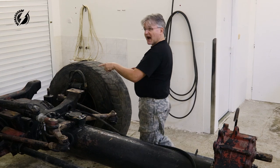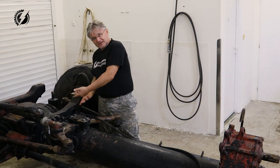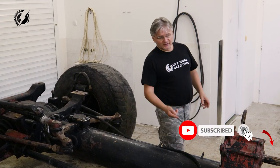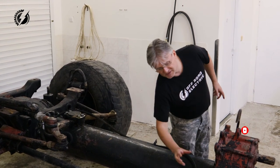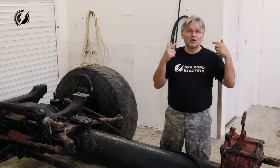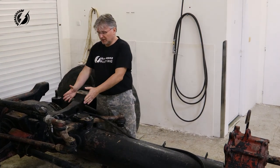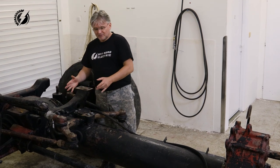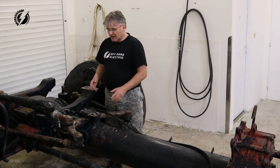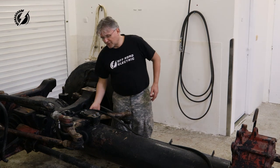Now, how am I going to put torque through the motors and transmission to the axle? I can do it through the Tatra differential — at the end of the differential on the shaft I put a gear, which is the first gear in this transmission, then the 2nd gear and 3rd gear, and both motors will work together through one set of gears. The problem is the differential has some length, and altogether it would be around two feet.